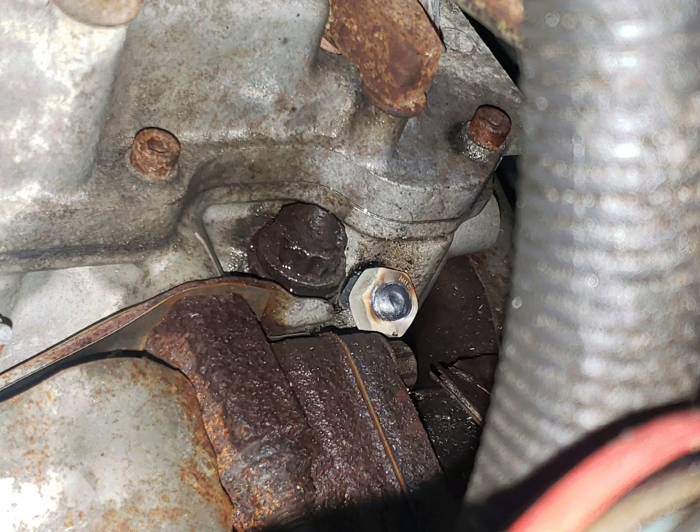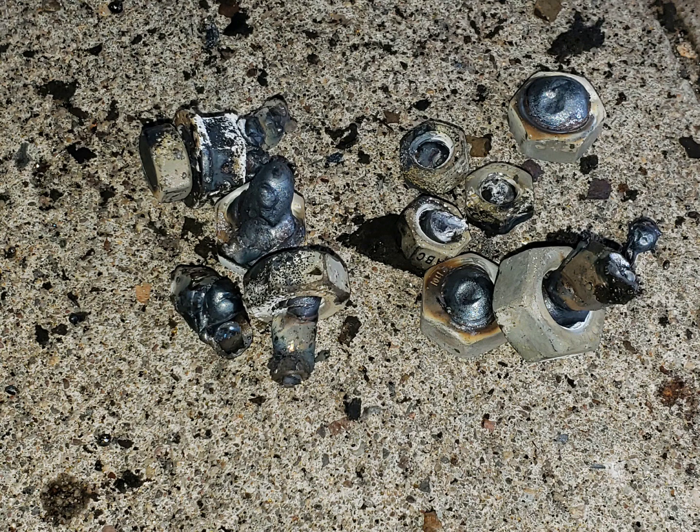I'd slide the nut halfway on and fill the hole up with weld. There's another picture of a second one. Don't get beat up over the welds breaking — it's very easy to get frustrated. I had a couple welds break. There's a picture of my first stack of failures, but in between those you get a little bit of heat down into the head, which is a good thing to penetrate and fracture up that rust and corrosion.